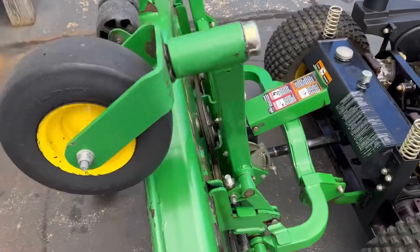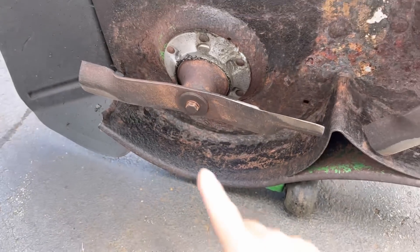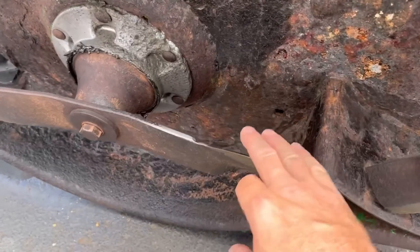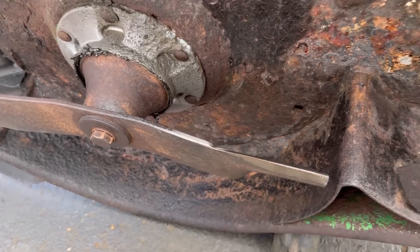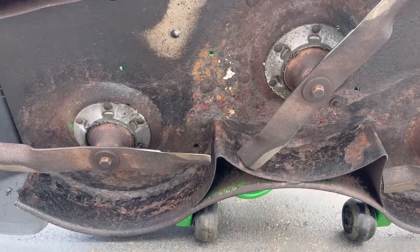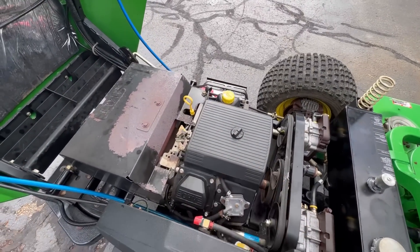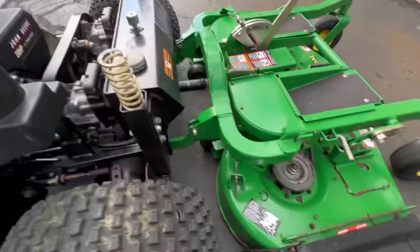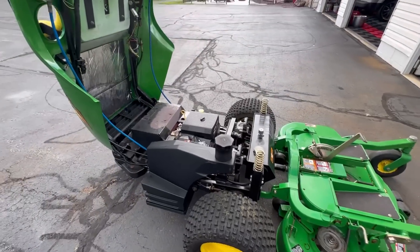Got the motor oil all filled up. I know somebody's going to say it — you forgot to sharpen the blades. Well, no I didn't. Just got done sharpening them up. I take them off, set them in a vise clamping sawhorse, and I like to use a flap disc on the blades — it leaves a much smoother edge on the flat side angle that you're cutting and a nice razor sharp bottom edge. So all three blades are sharpened up. Oil's topped off, air filter, fuel filter, engine oil filter — all done. I also re-tensioned the drive belt on the thing, made sure it was right, and gave a little adjustment tension on the mow deck belt.